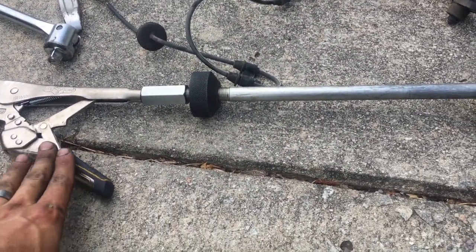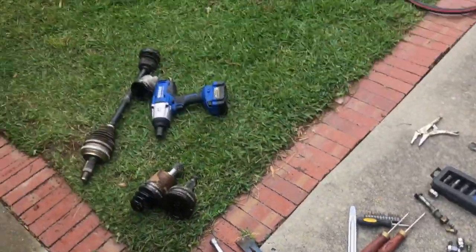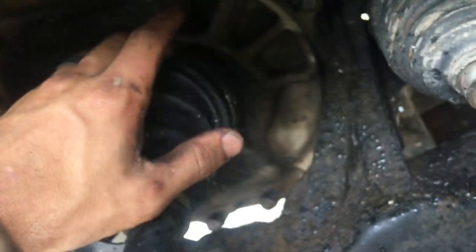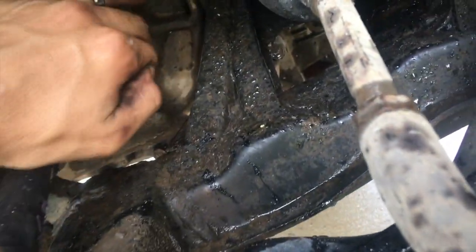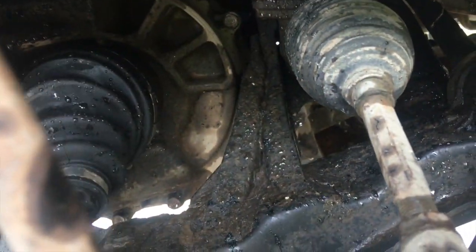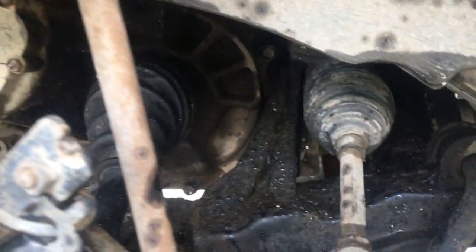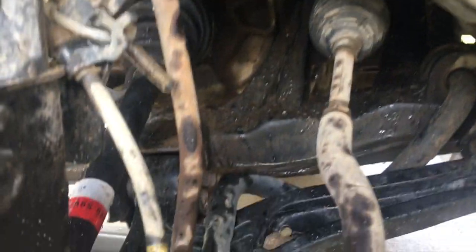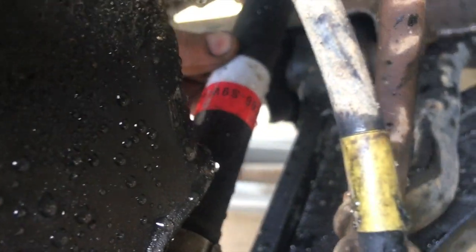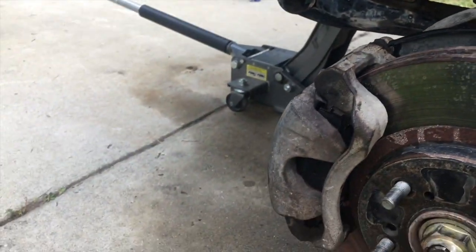At the salvage yard I used this method carefully — I scooted the boot back and was able to get the vice grips on just enough to give it a pull, so I didn't have to get under the car and use a pry bar or hammer. On the passenger side it's nearly impossible since there's too much around where the axle goes into the transmission. The axles I got look like they're in really good shape; we'll see how long these last.